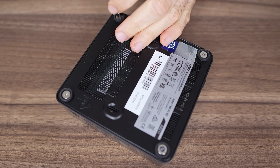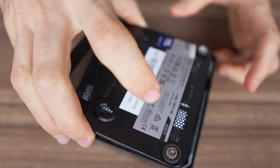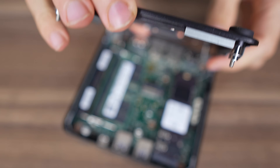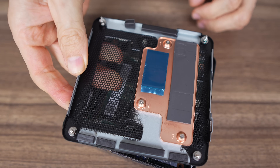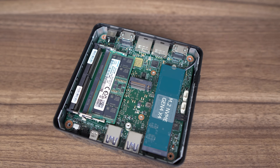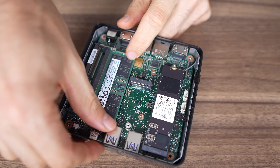It's straightforward to open the Qubi with just four screws to loosen, then lift up the metal plate. A thin slice of copper is underneath, which connects to the SSDs via thermal pads and acts as a heatsink. The main storage slot is a 2280 M.2 Gen 4x4, and for secondary storage there's an M.2 2242 SATA. Underneath the OS drive is the M.2 wireless card.